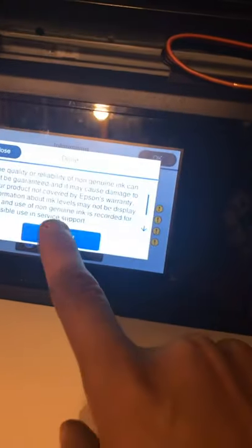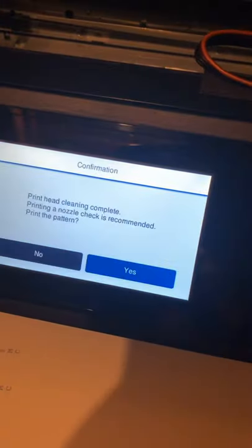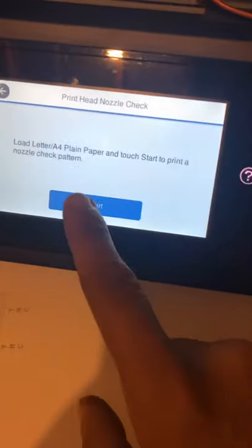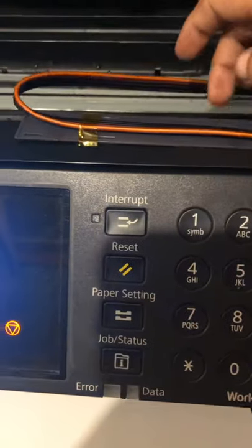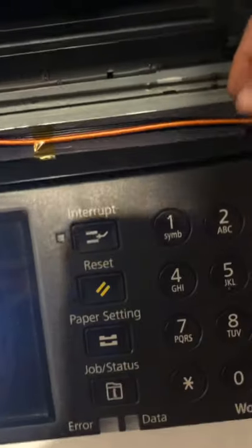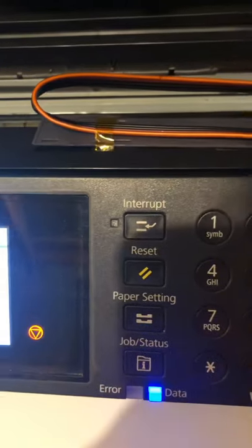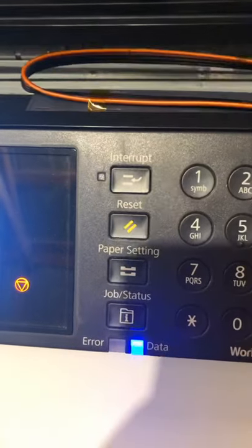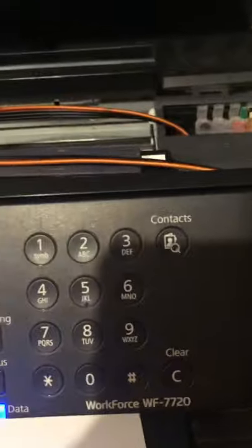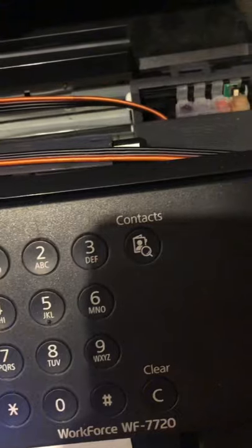Alright guys, there's a few things I want to talk about. In this instance, what was happening to my inks. I had done a video to install this bracket with the pieces on top. However, the cords were pinched and compressed so much that it didn't allow the ink to flow through. This problem always fixed itself because when I remove my ink cartridges, I move everything around and it just so happens to unkink.